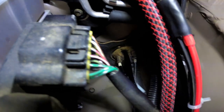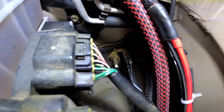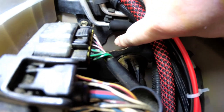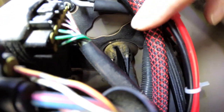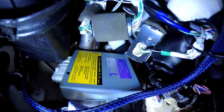My wire harness pulled through there. I ended up cutting a little hole, and I would just recommend that you're very careful down there because there is a big bundle of small wires going through that, and it could be a real disaster if you cut one of those. After the fact I kind of wish I would have just drilled the firewall right here and used a grommet to get the wire through and just had its own spot. Looks like it's going to work out okay and I don't think I messed anything up, so I'm just going to put a bunch of silicone on there.